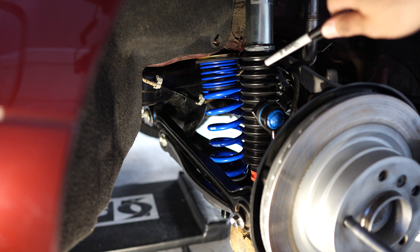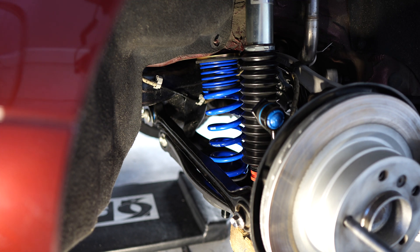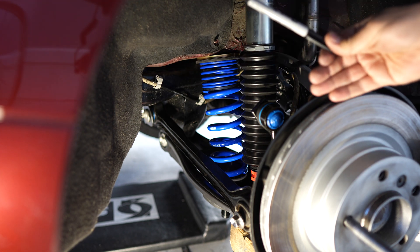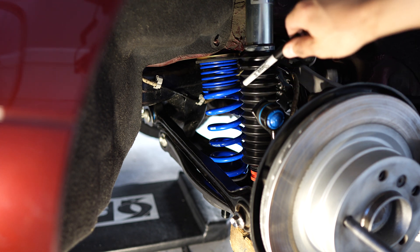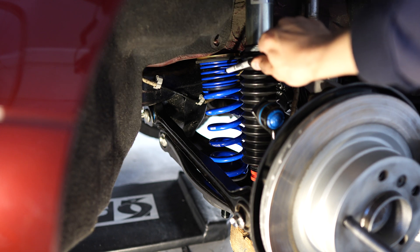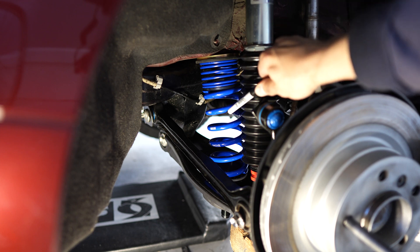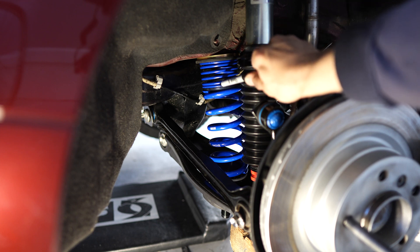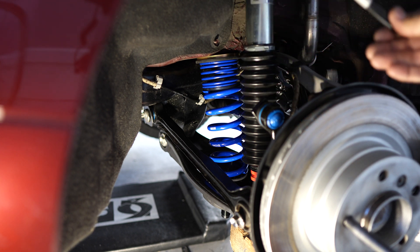It's a standard 60-millimeter spring and it's about 170 millimeters long. When the suspension is completely unloaded and this main spring is not loaded at all, there would be an empty space if there was no helper spring on top of the main spring. The main spring is about 170 millimeters and it's just not long enough to take up all this space when the suspension is in its lowest position.